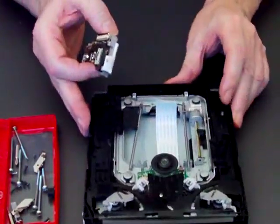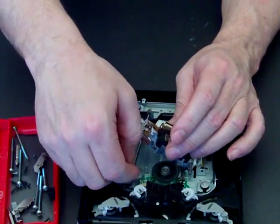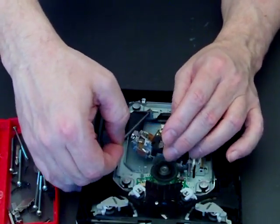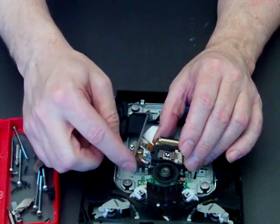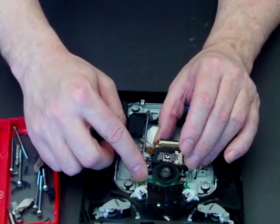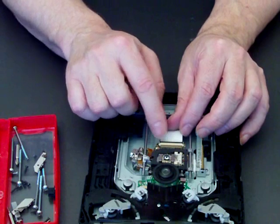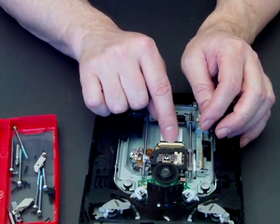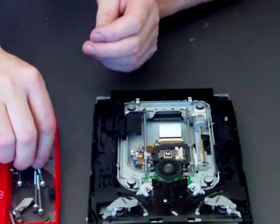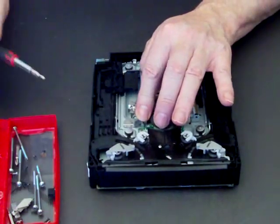Now we're going to put it back into the machine. We lift that arm, slide it on, lift the other arm and slot it underneath. There's a little spring here and a little guide — it goes over the top of the spring and underneath the guide, then back into its slot. Reconnect the data ribbon and make sure it's square and perpendicular, lined up, because if it isn't it will not work. Then these springs — this one always seems to go on quite easily, just pop it back on.